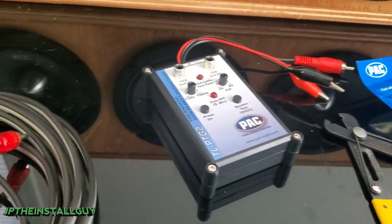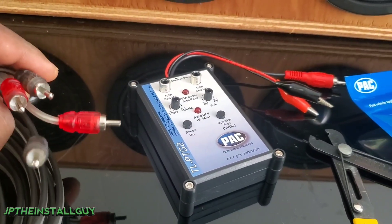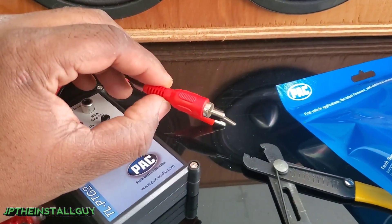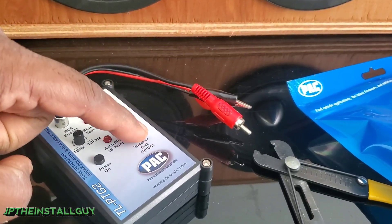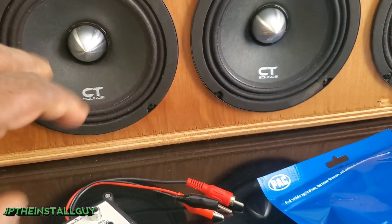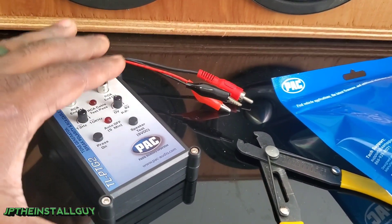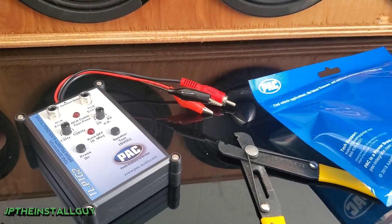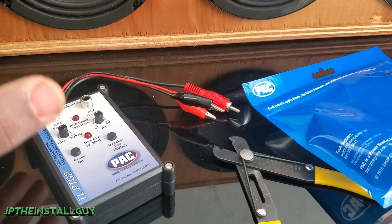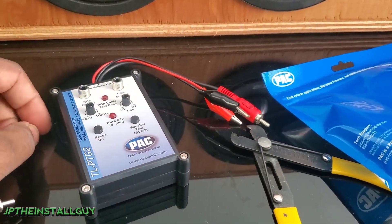What I usually do when testing signal at the amplifier: I take the RCAs out first and use the RCA tester to confirm they're good. Then I take the male end and stick it into both sides of the amplifier's female RCA input, and I can still pop from here — it will send that pulse through the amplifier through the RCA, and you should hear that little popping sound coming from your subs or your four-channel amplifier to the speakers in the car. I'm going to make a follow-up video about this tool focused on troubleshooting amps, since you guys really like troubleshooting content — that link will be in the description.